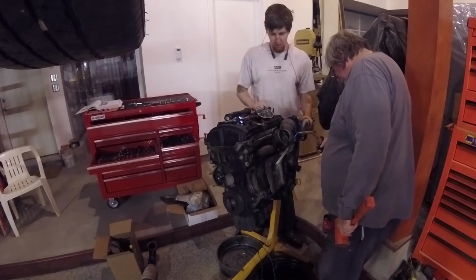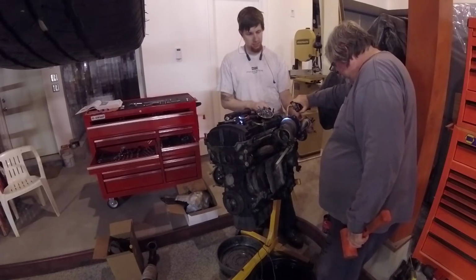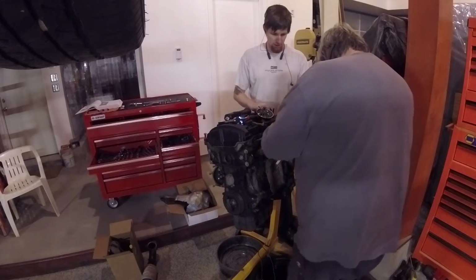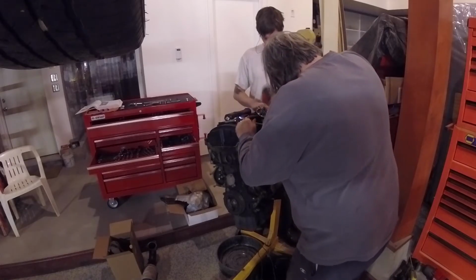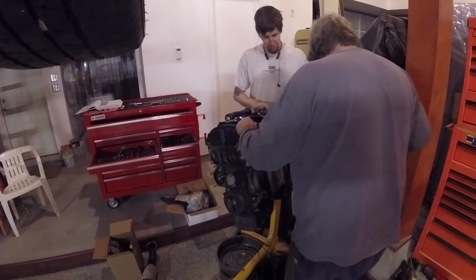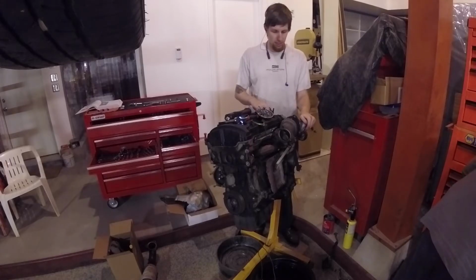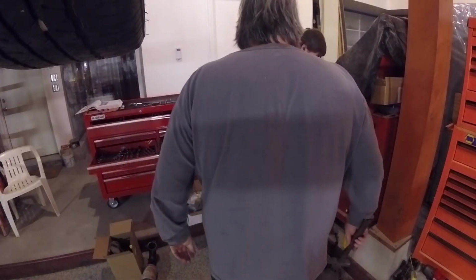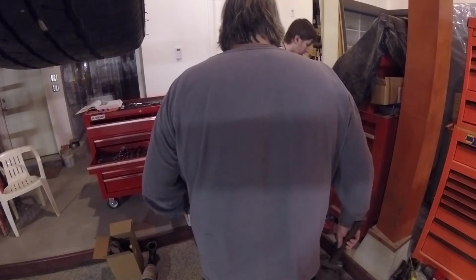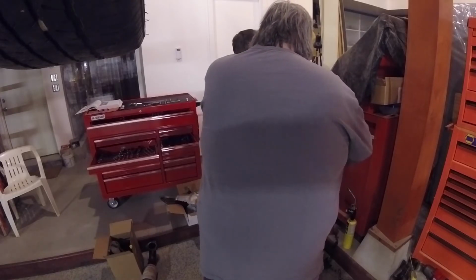Time to get the map gas out. We heat up the volute. You want to be careful with this stuff. It is cast iron on the manifold and the exhaust side of the volute, so it can be quite brittle and obviously quite hot when you hit it with a torch. So be gentle. Don't go beating it heavy, otherwise you will probably end up breaking something. We do switch over to, I think that's a 4-ounce cross peen hammer, just for a little bit more precise impact control.